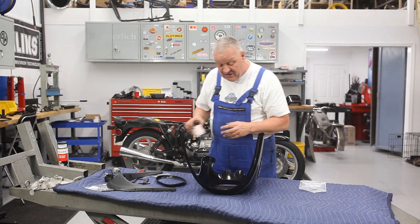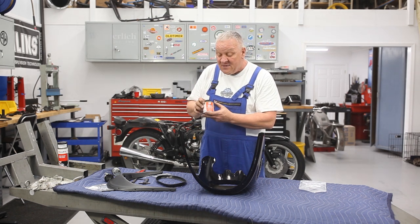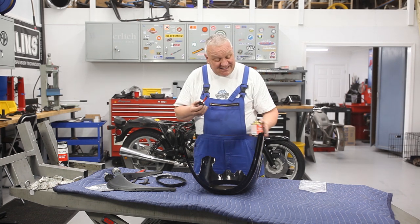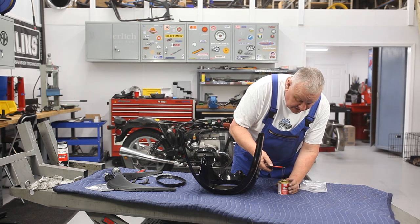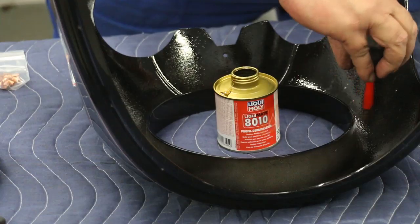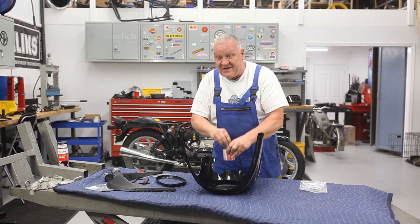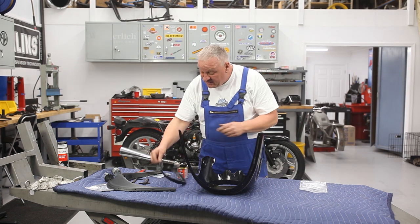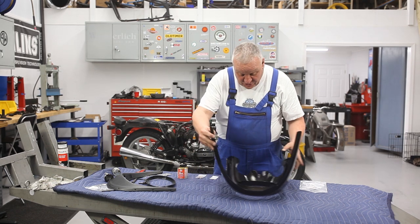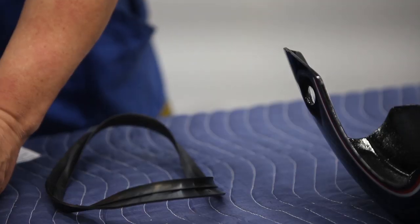To install the gasket it's going to take a little bit of time to tack up. I've got this Liqui-Moly 8010 rubber glue — really cool stuff. We have to put it on both surfaces and let it tack up before we put the part on. I'm just going to go around very carefully and put some right on the outer edge all the way around, about a centimeter — about the width of the step on the gasket. That's all you really need. Leave that to tack up, then put some on the gasket itself too.